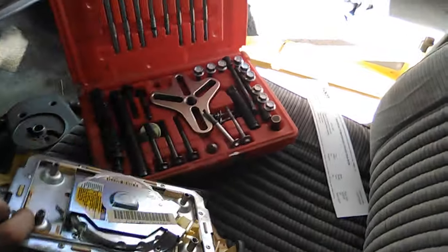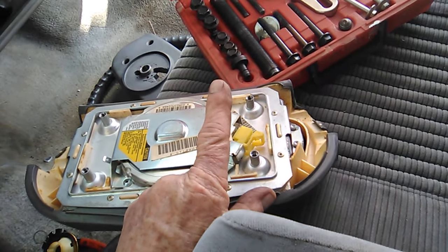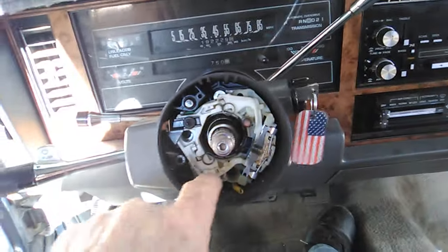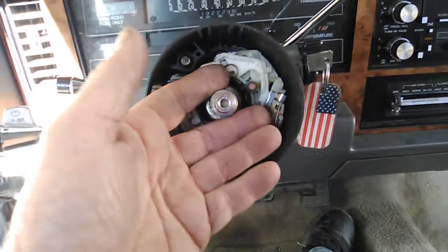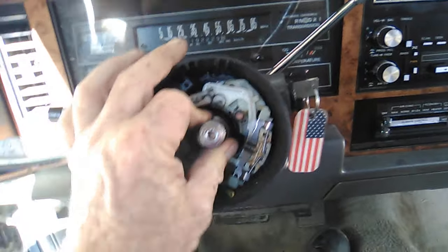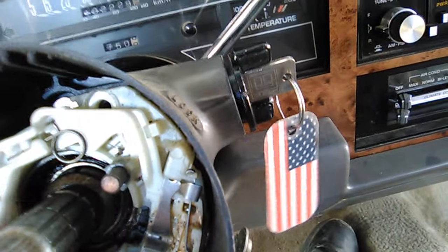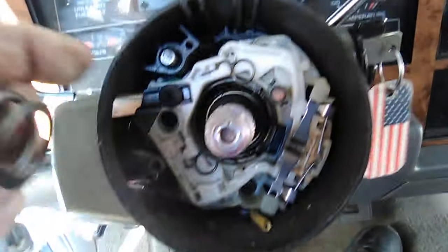And when I pulled it out, I think I pointed out the fact there was absolutely nothing connected to this connector here. So there's a wire harness that plugs into this, goes through this clock spring device, and then goes through the column to another connector on the other end. So with that missing, there was excessive play between the lock plate and this tensioning spring, and that's why there was nothing holding that bearing into place. The bearing seems to be okay. It's just when this spring is not here, well, there's a bearing down in there that needs to see tension on this little cup here. Otherwise, it can wobble around in there quite a bit.